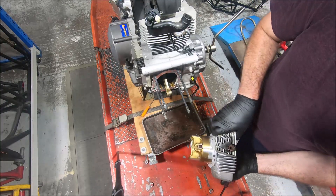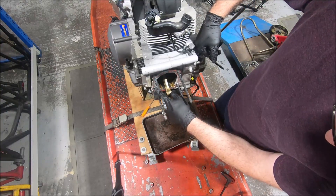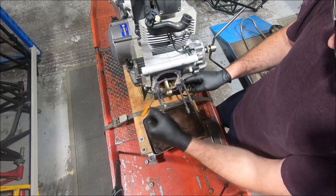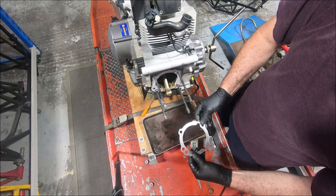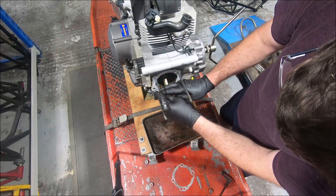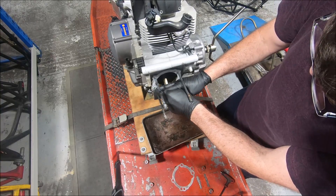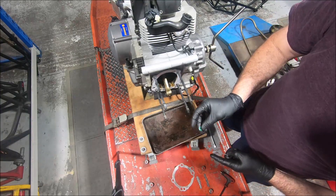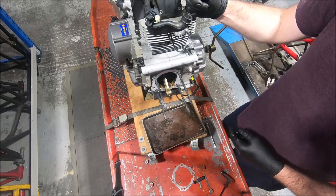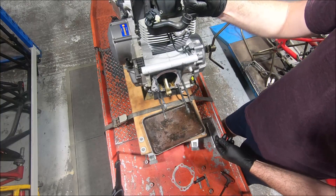This is the main difference between the DS style and the earlier style - the location of this oil feed. It's not the same and I don't think they will match up. This one's actually O-ringed, which I've never seen before on one of these. These were always just a gasket with a bigger hole in it and a sealant seal for the oil feed to the horizontal cylinder head. But now they've gone to putting an O-ring in there, which is what they used on the vertical years ago. They took the O-ring out, had leaking problems, then had a couple of goes at replacing the O-ring with a much more complicated system to fix the leaks that not having an O-ring generated.